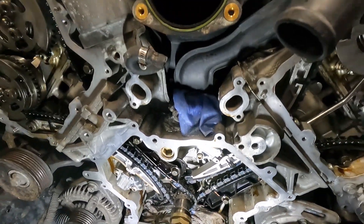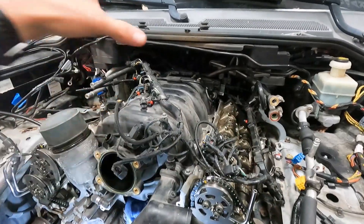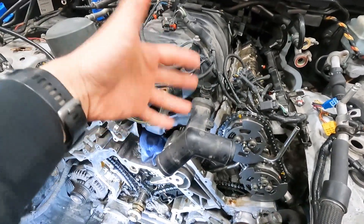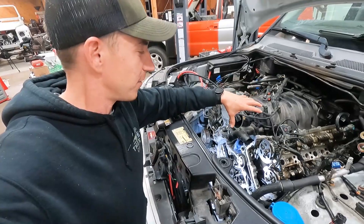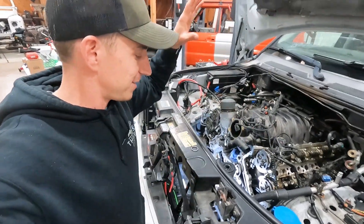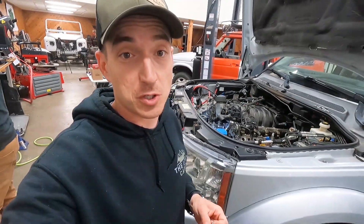She is all good to go — get the valve covers back on. We'll wait until everything's closed back up to pull the intake manifold off and replace all the plastic coolant housings that also break. This guy will be all freshened up with the major maintenance items: coolant housings replaced, water pump replaced, timing chains done, and new PCV valves — she'll be good to go overlanding.